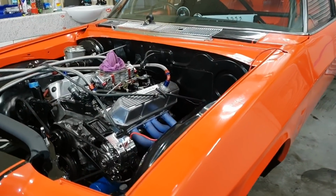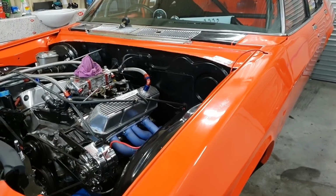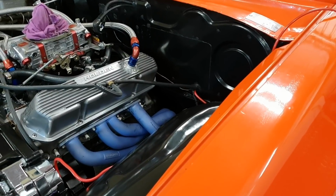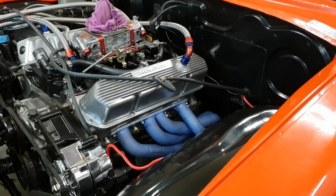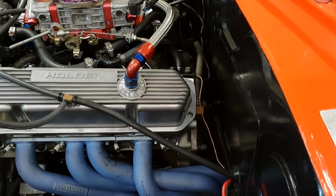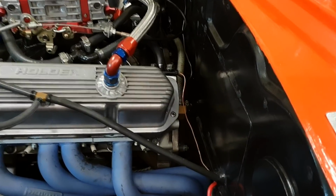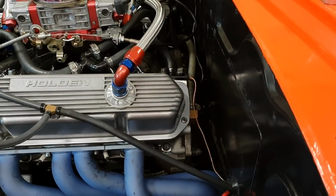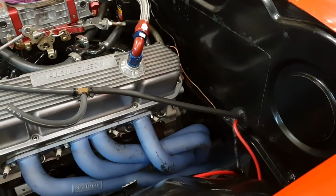Well guys, I've got a couple of things I'm going to do to the car. One in particular is very significant, and the others are important, but I'm going to start by putting on a torque strap. I had a fella comment on it, suggesting I put some sort of strap from the back of the engine onto the chassis, because I actually broke an offset stud, because I run an adapter plate, guys. This is an early Holden Trimatic pattern on the engine, and I'm running a Turbo Hydromatic 350, so I've got to run an adapter plate. You can sort of see it down in there. It's around 20mm thick, which gives me a chance to weld a lug off the adapter and make up a nice bracket off the chassis and do some sort of torque strap.